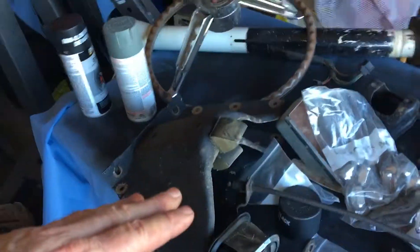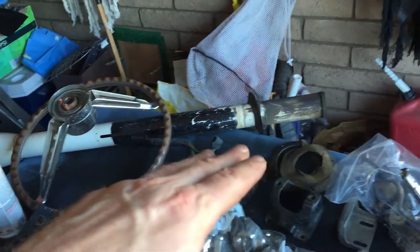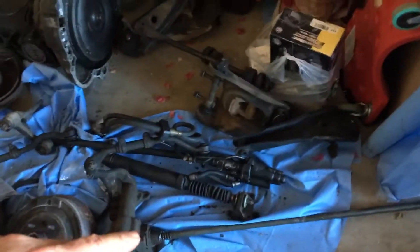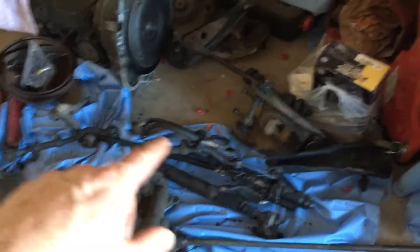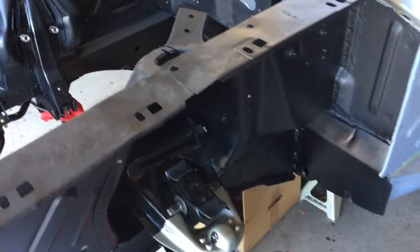There's my spring covers, and that's my steering wheel shaft which I'll have to modify once I get my Randall's rack and pinion in. I'm going to put rack and pinion in this instead of all this junk over here — that's the old steering box which gives you that boat feeling — along with the slave cylinder and all those joints. Basically getting rid of all that, so that's going to be real nice. Should have a nice steering vehicle once I get this all together.